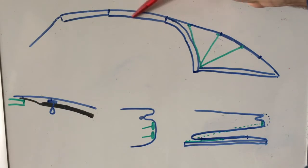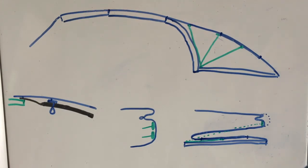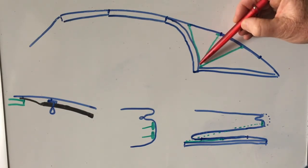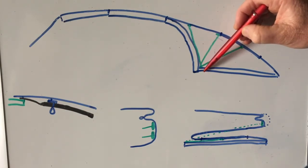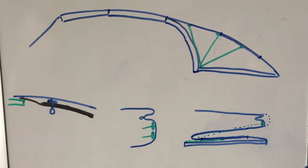So when this actually moves, this bit of the roof here is actually just fabric that's just going to fold as required, whereas this one up here is all hard, connected to the aluminium piece up the front. You've then got the big seal at the back here, and behind here is the arm that actually moves. So when the motor moves, which is down here, it's just going to rotate this piece here, and there's a whole bunch of other connection points that are connected to it.